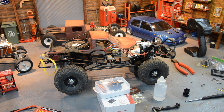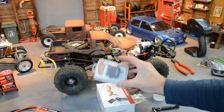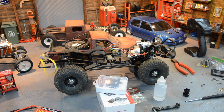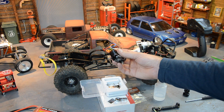So then next step, we're going to upgrade from the 1060 Hobbywing QuicRun to the 1080. Talked about that a little bit in the video. It's got a programming card. We can up the voltage for the BEC to run the new Reefs 444. The first real nice servo I've had in a very long time. The only servo I've ever had on that level was a ProTech that I had in the Blazer. And that was a very expensive servo. Reef stuff's pretty expensive too, but this thing is beautiful. And everybody tells me that I'm going to love this.